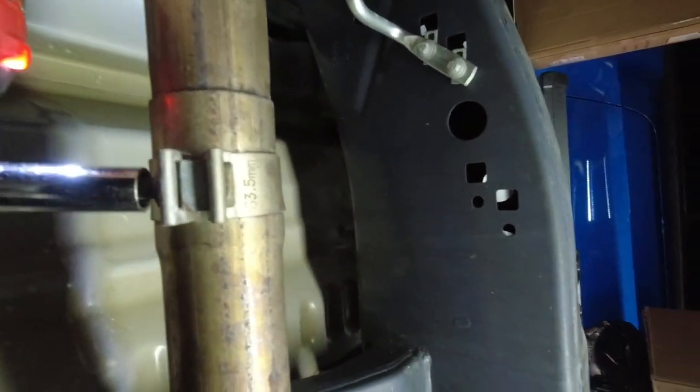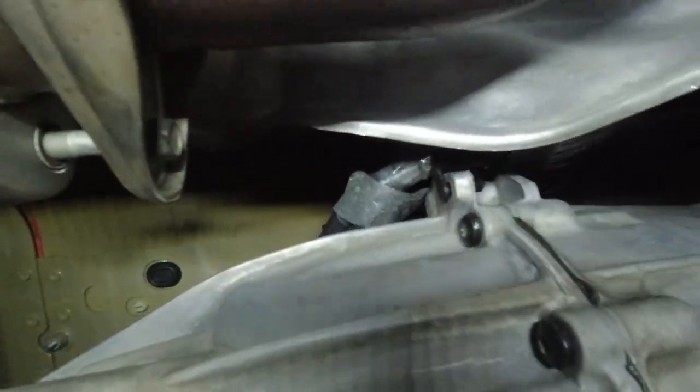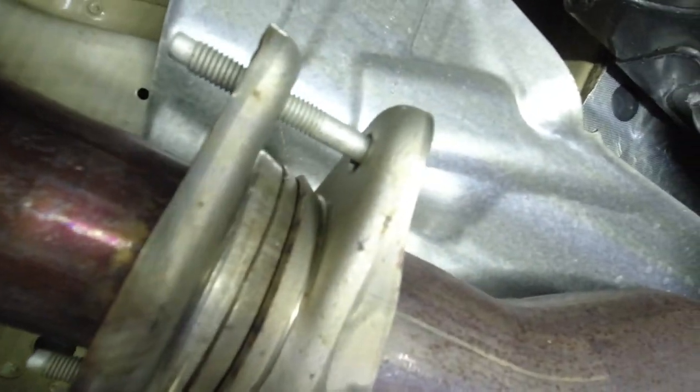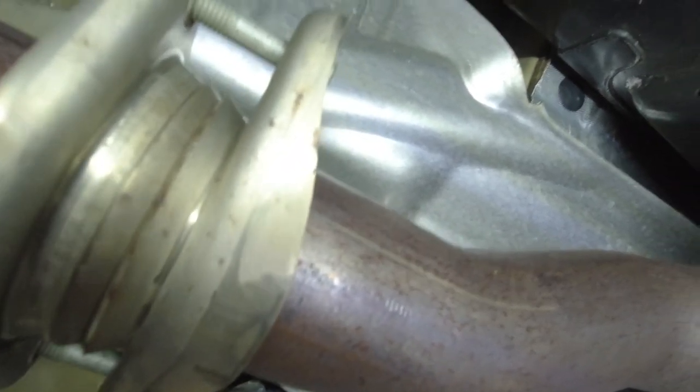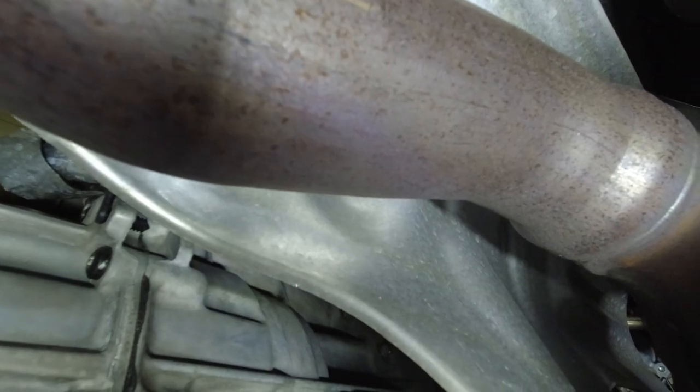Alright, that's plenty loose. Now there are two bolts on this collector right here — you can probably see them right there and there. On the back side there's actually not a nut; the back side of the slip flange is threaded, so we don't have to worry about the other side. The instructions say to loosen them but don't remove them. We're going to swap the socket on our electric ratchet — these things are amazing, I highly recommend them if you don't have one yet.